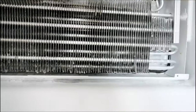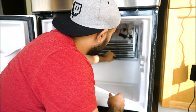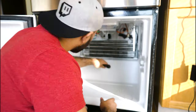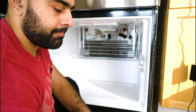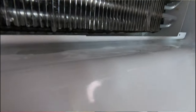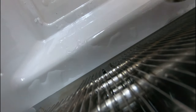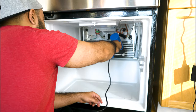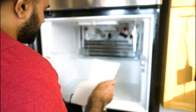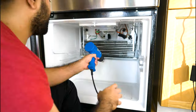We need to thaw the drain so water can go through and the freezer won't leak anymore. Use a kitchen knife or screwdriver to bash away the bigger chunks, then wipe it off — but be extra careful not to scratch the plastic. Once the bigger chunks are removed, grab the heat gun and melt the remaining ice. A couple of cautions: don't continuously blast heat since the back panel is plastic and can warp, and be careful not to burn yourself as some parts get really hot.